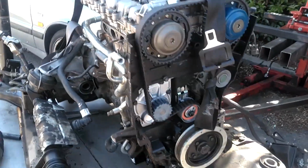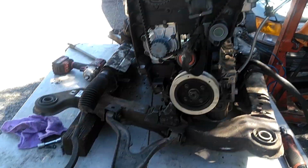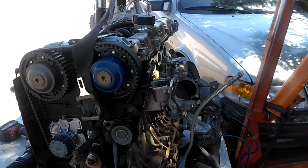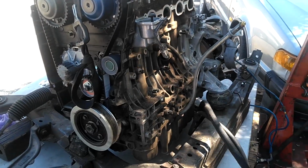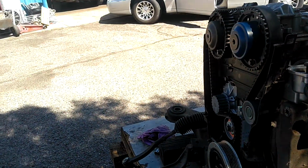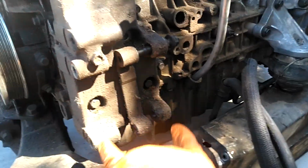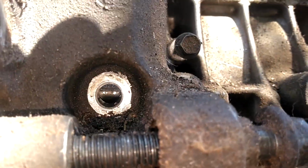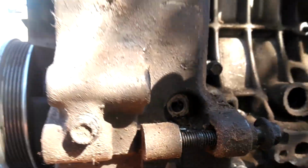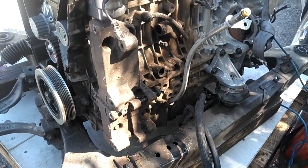Now the engine is mounted onto the subframe. I gotta take these control arms off and swap the stuff from the old engine that we're going to use over to the replacement engine. Installed the accessory bracket off of the engine onto this one. I got 2 bolts here, 2 bolts here, 2 bolts here, but this bolt right here doesn't line up, so I only got 5 out of the 6 installed. I guess that'll be good.